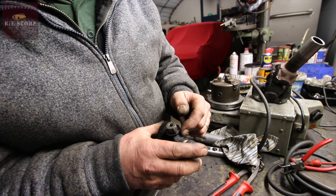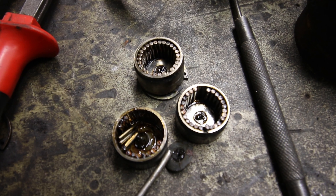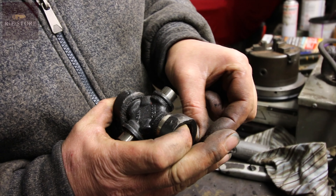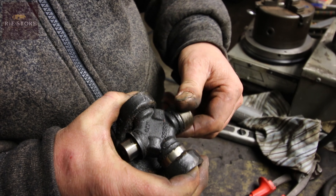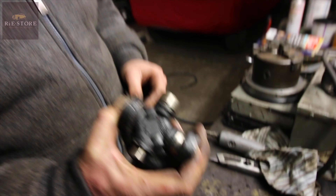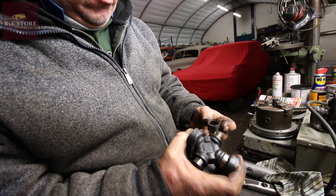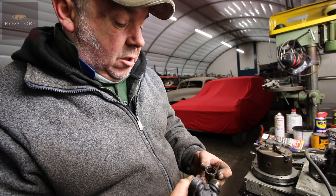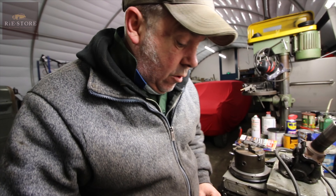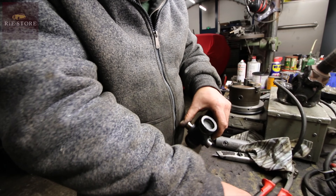Why would you normally need to take one of these joints apart? They wear out. There's no grease nipple in this one — you get ones with grease nipples and ones without. The ones without, like this one, are pre-packed with grease. It rotates at speed with no grease, it just chews itself up to death. So you have to change your UJs — quite a common thing on older cars. A lot of them now go to CV joints, but on the older stuff, UJs going is a common fault.